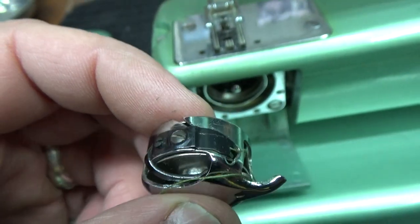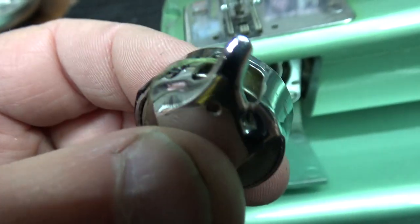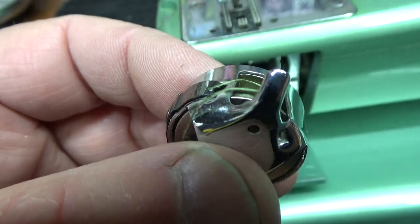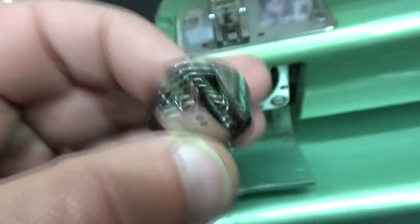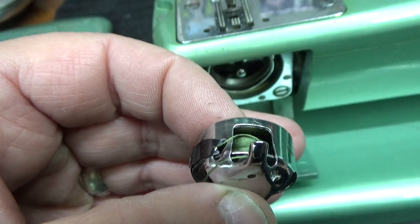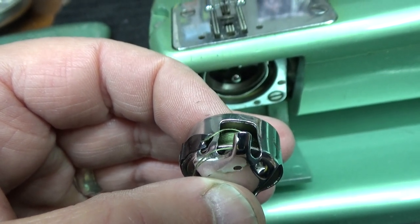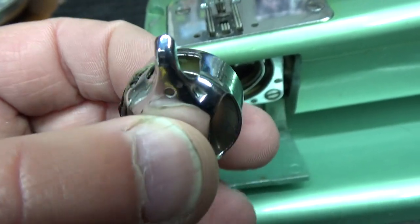All right, I'm not looking at the chat, but if someone typed in the chat, it helps define the top stitch. It's basically, as it's in the raceway area, pulling down on that thread as it's fed up and going through the sewing cycle, and it's pulling down to define that top stitch, then you're absolutely right.